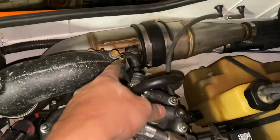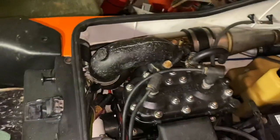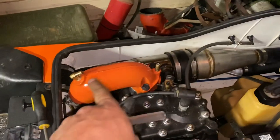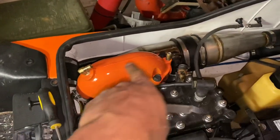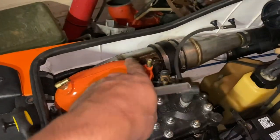At the SX, we'll pull the three bolts. I got these clamps loosened. I'll pull this one off. I got the other one painted. Got the painted head pipe that I tapped, bolted on. Got the clamps tight. Now I'm replacing from head to manifold.